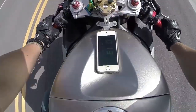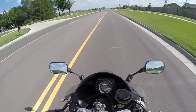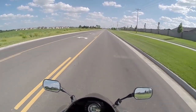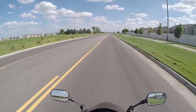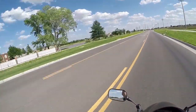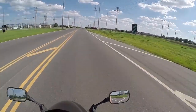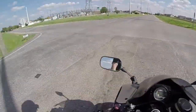I was getting worried there for a bit because I put it in once and went to test drive it and my speedometer was way slow - it said I was doing like 10 and the GPS said like 25. So I went back and put what the calibration was in and it jacked it all up. So I reset it, went out and did it again, put the calculation in again and it came back the same 18.3 - which was my original fix for it. That's what it's at now and it's reading perfect. There's 44, 44, 43, 43 - hell yeah, we're right on. I know how fast I'm going now for real. When I see cops on the highway I don't have to worry if I'm speeding or not - I was guessing by maybe 15 miles an hour before. Got it taken care of now.